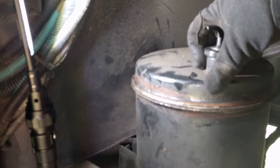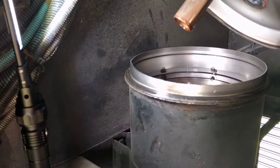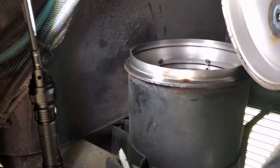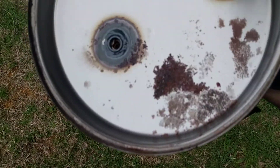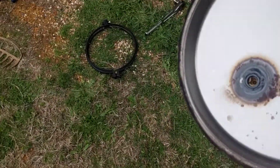If you pull this tank off and take the lid off — I can show you there's the lid — and I've got a little bit of rust in there I need to take care of, which is not good. You don't want rust in there because that will drop and get in your filters.